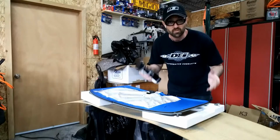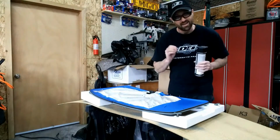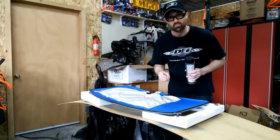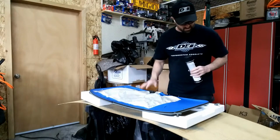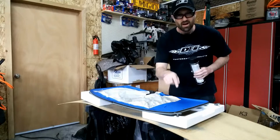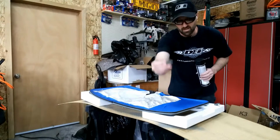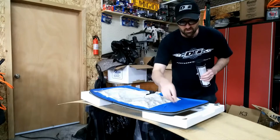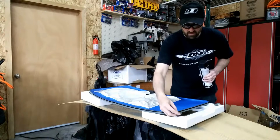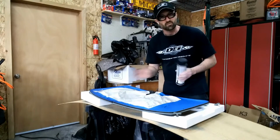Okay, so I've flipped the sunroof over. The reason was this bottom edge had a little bit of the etching primer on it, so I want to paint it black. And you notice everything else is covered except for the handle, which is fine. I won't spray it. I also got 2 of the buttons taken off. These are just the pieces on the front of the latches itself that actually go down in the channels. So I'm just going to set those up. These already have been primed with the etching primer. They're already scuffed and primed.